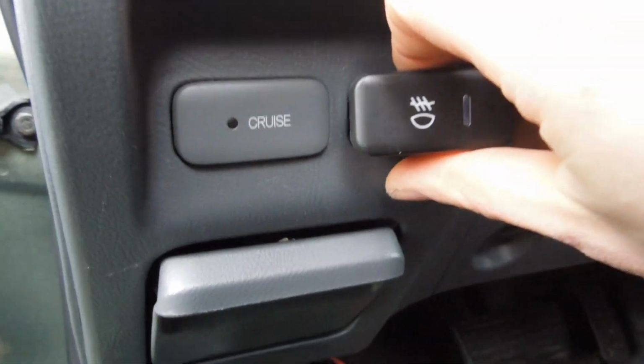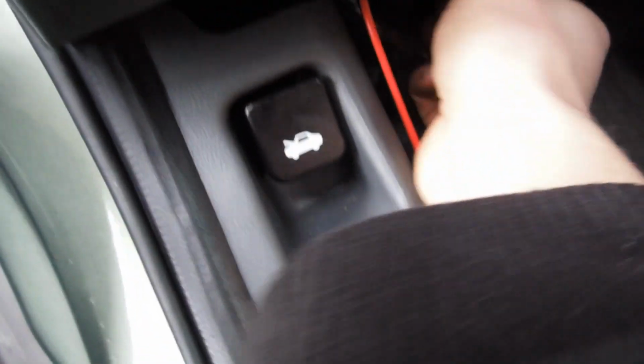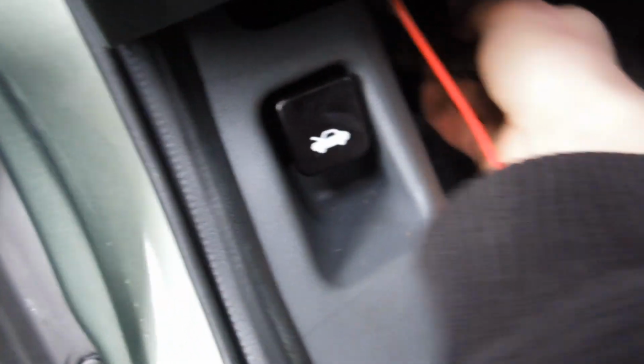And the next one, of course, is I also reached around into here, and right from the back end, just reaching around, I was able to pop that out. So now I have the spot for my switch. So we also have left the wire, of course, the positive at the back of the switch. And here's our relay. The relay I'll tie in somewhere. But there's the back of the switch, which will come through that hole.